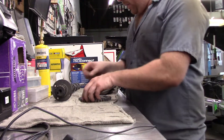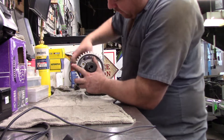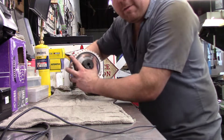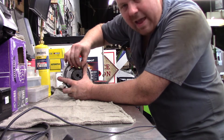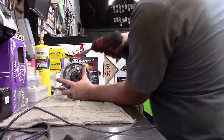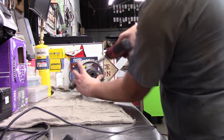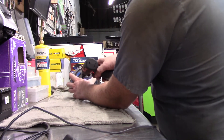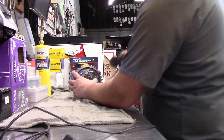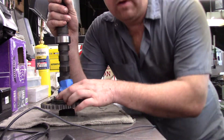What I do is get good grade 8 bolts and mark the gear to this. This is something so simple — if these bolts are too long, as the cam walks back and forth, even if it's like a thread too long, it sounds just like an engine knock.